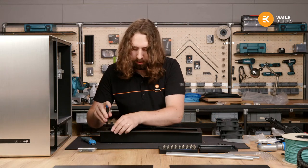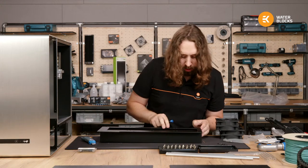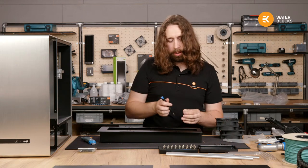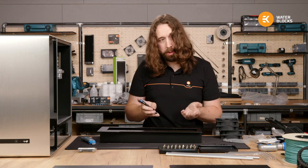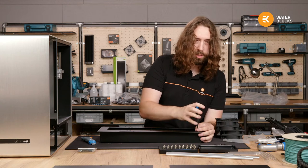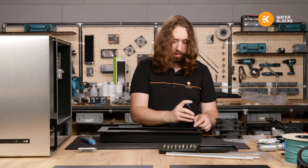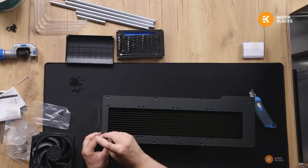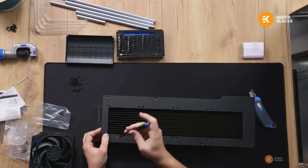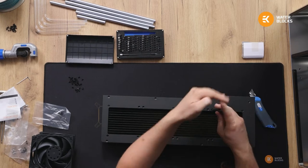Yeah, for sure overkill. I think one of my favorite builds I ever had, I had a rig with three 780s in SLI, and I had three 360s and a 480 with a single D5, and it was just absolutely silent. I used to run the fans at 400 RPM, whether I was idling the PC, browsing the internet, or benchmarking and overclocking all three of the cards to the limit, so that's what I want to have here too.